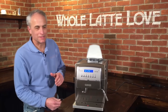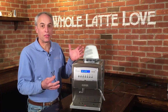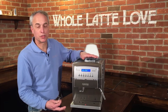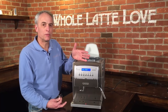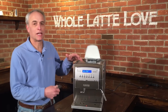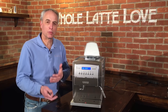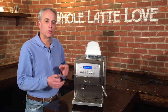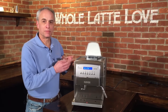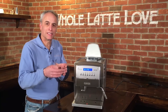No coffee — so that's no fun. That could be caused by basically one thing, or a couple of things. Either there's a serious problem with the grinder, which is not normal, or the chute between the grinder and the brew group gets clogged. That could happen for a few reasons. If you're using oily beans and you've been using them a while, your burrs wear out a little bit — that could help clog up the grinder, or the beans and oil gets inside the burrs.